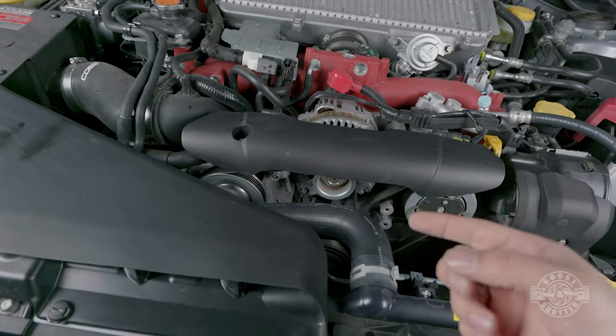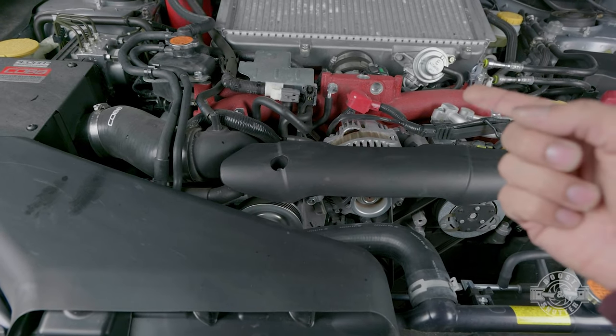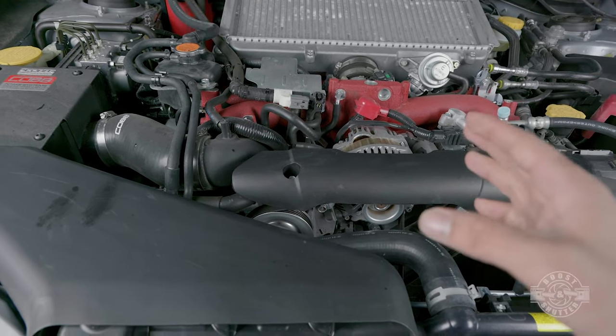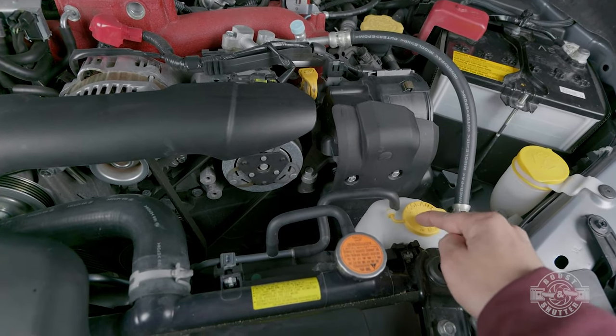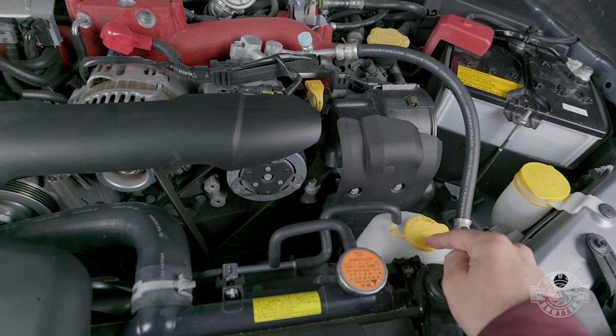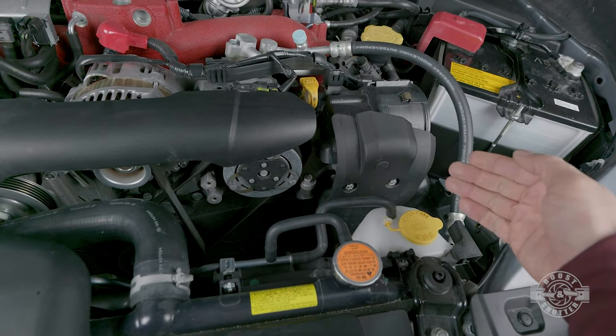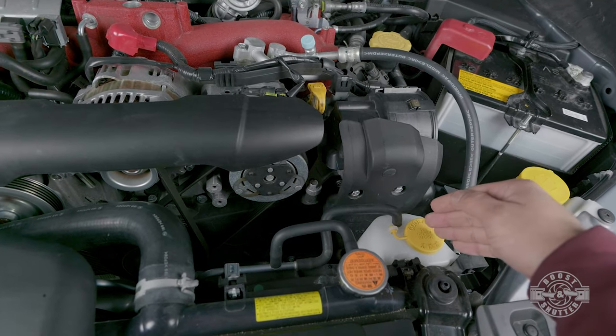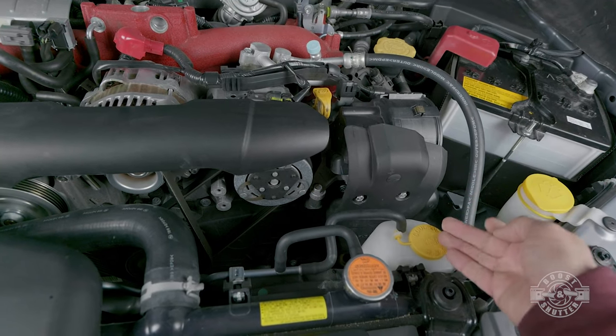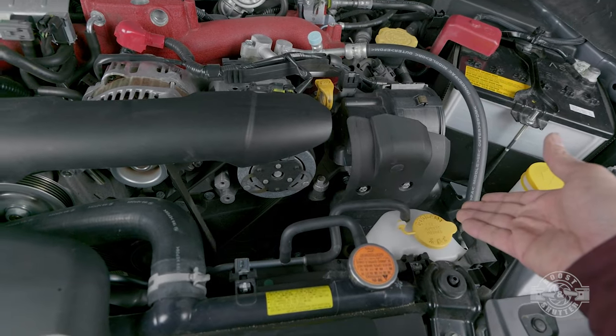For the next week or so, make sure you monitor your temperature inside the car — make sure you're not overheating and that everything looks normal. Every now and then when the car is cold, take a look at the overflow tank and make sure your coolant is still within those two lines. If you need to add any once the car is cold, fill it back up to the fill line and you'll be good to go.